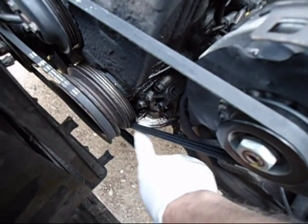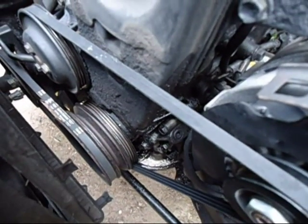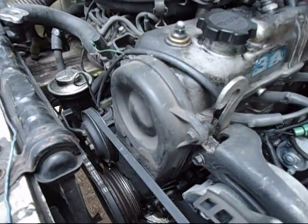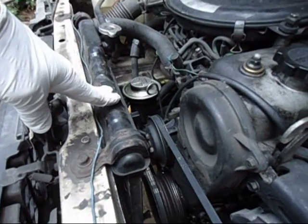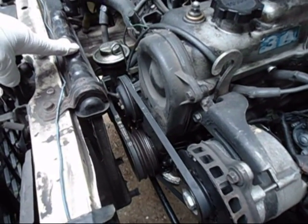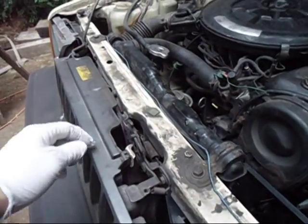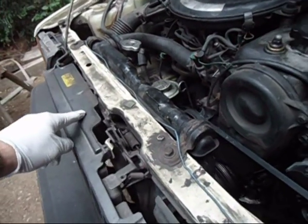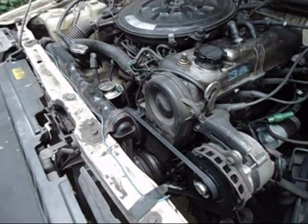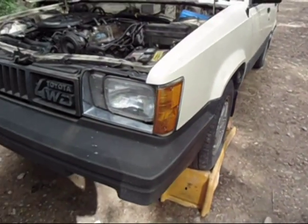You can see oil along here — I'm pretty sure the front main seal is bad, and I plan on replacing the timing belt too, it's about due. My technique is to pull the radiator; I need to pull it anyway because I want to put a newer radiator in. Remove the front grill and the fan so I can get at the bolt on the end of the pulley. I've elevated the car so it's easier to work and easier on the back.